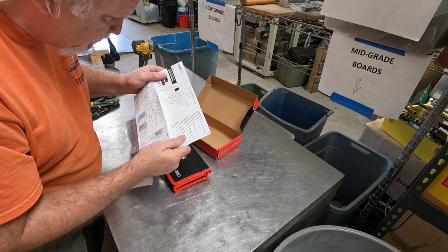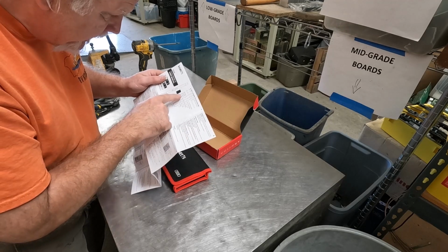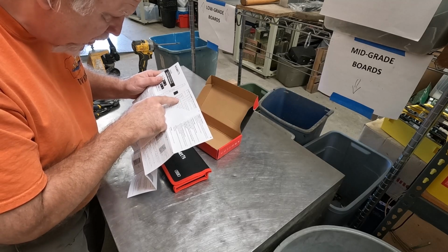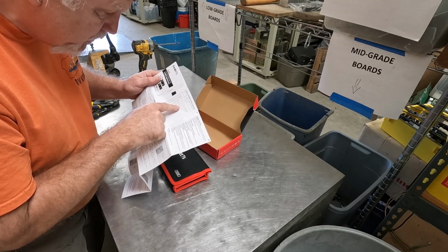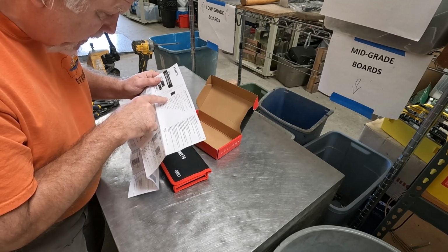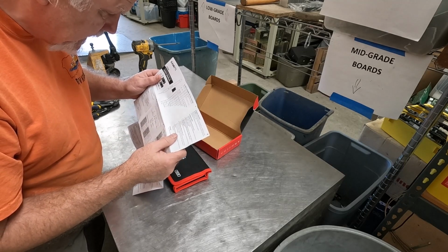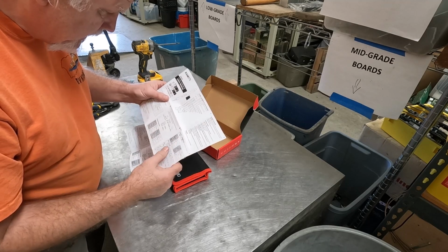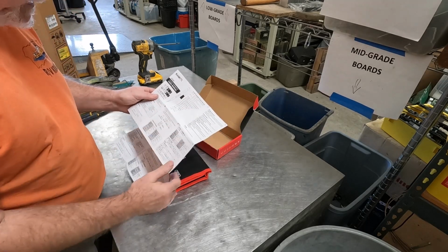It has 120 pieces: hex heads, Torx, security Torx, flat heads, nut drivers, Phillips, you know, the small sizes, quad aught 2, triple aught 2, double aught 2, aught 2, 1-2, and 2-2, tri wings, positive drives, pentalobes, triangles, U-drives, squares, mids, and sims, conical needle, a game bit. So it has an adapter, a quarter inch adapter, ICS-20. So they've thought through the types of bits that they should include in here.